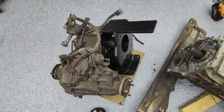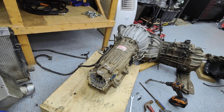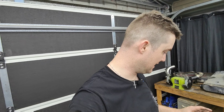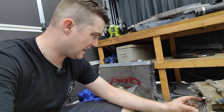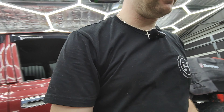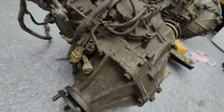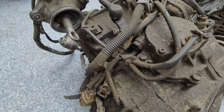I've got the adapter plate bolted on to the Land Cruiser transfer. I've test fitted it onto the back of the 4J auto gearbox and it all looks really, really good. Unfortunately I don't have any RTV or sealant today — I want to seal all the way around here purely because I don't want water getting into the splines and making their way into the gearbox. So I'm going to put some RTV sealant in before I bolt them all together. Another reason I'm not doing it today is I want to clean this thing — look how dirty this transfer case is from 30 years of being in the car. It is just absolutely filthy.